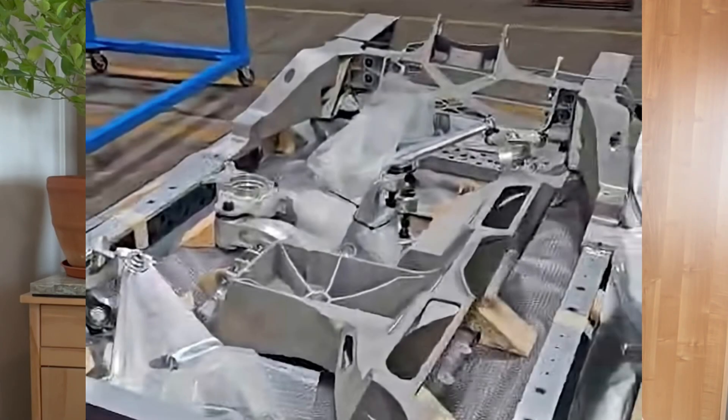In the next part of the video, we see one of the completed frame assemblies that CoStamp has kitted up for shipping to Aptera in Carlsbad. In the center of the frame assembly, you can see what I call the rear frame tusk — the component that mounts the rear wheel to the aft part of the frame. There are two large aluminum cutouts in the bottom of this component, and two smaller cutouts to the left. Looking to the top, you can see the secondary frame cross member with the X-Brace and how much aluminum has been removed from the design. The removal of aluminum is the removal of weight. You can also see on the two front frame horns, which mount the front suspension, there are two oval lightning holes removing more weight from the frame design.